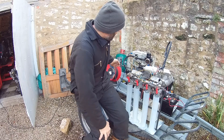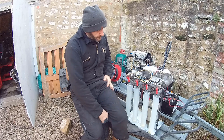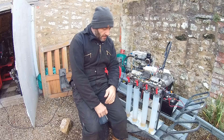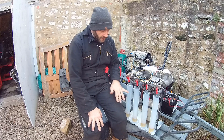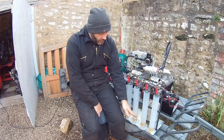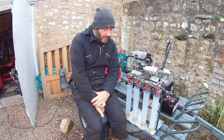I'm going to switch it on. There's our fuel pressure. I've got this programmed so I just touch this wire onto there — and we're running. I've got a timer running on the program so I can change the time. For higher duty cycles we run it for a shorter time so it doesn't fill up the 500-milliliter measuring vessels. All we do is look at the fuel level once we've run it for a certain length of time.